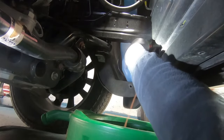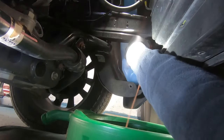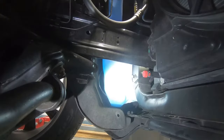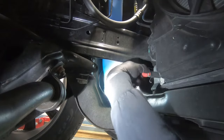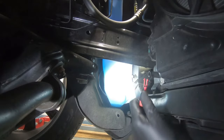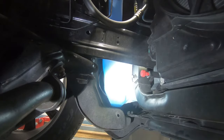I'm going to spin this out, get that flow going, and let it run. Once we get to a slow drip I'll pull the whole petcock out and make sure nothing else is coming. Looks like we're about dripped out, so I'll put the petcock back in and leave the drain pan there to catch any remaining drips. Now we'll go ahead and get into disassembling everything we need in order to get to the water pump.